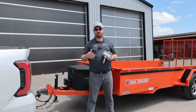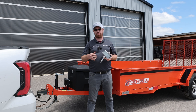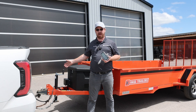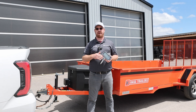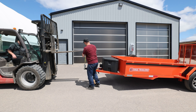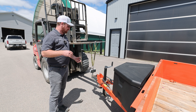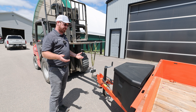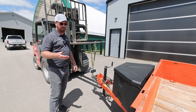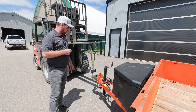The first test we're going to do is actually unhook this trailer, hook up the scale, and see what tongue weight the empty trailer puts toward the truck — first with the hitch too high and not level like it should be, and then comparing it to the level position. We've unhooked the trailer from the truck and put it back to the height it was at on the truck: 18 inches on the front, 11.5 on the back frame to ground, to incorporate that angle.